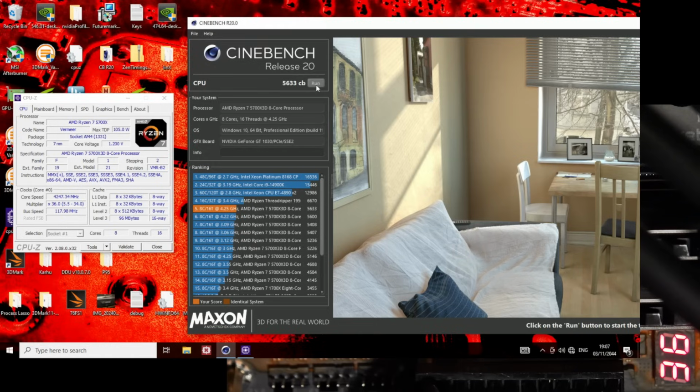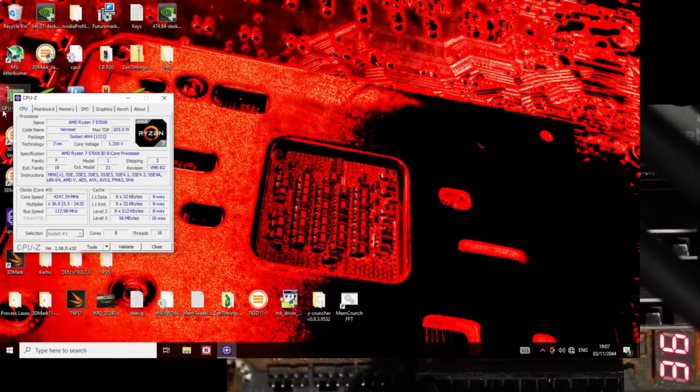I mean, that's basically what I'm doing here, except instead of using the core ratio like you would on an unlocked AMD CPU, where changing the core ratio disables all of the safety features. I don't like that. It doesn't make sense to me that the core ratio would be directly linked to all of the safety functionality, right? Because I can have all of the safety functionality up and running with a BCLK overclock. Now, at this point, I'm relatively certain this is going to crash in Linpack.